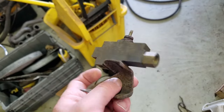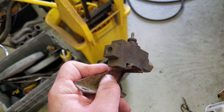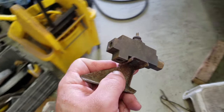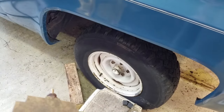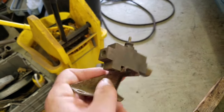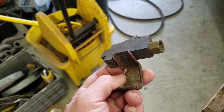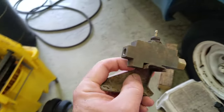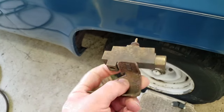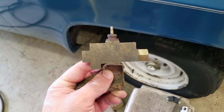But if on your Chevy you ever have a situation where you cannot get fluid out of the front or back — like say you bleed the front brakes and they have pressure, but the rear brakes just trickle — this is the reason. It's not some magic. You shouldn't just eliminate this, because you're going to get a terrible pedal, rear brakes locking up, all kinds of terrible things — which some guys on the Chevy truck group say you can do just fine. No, don't do that.